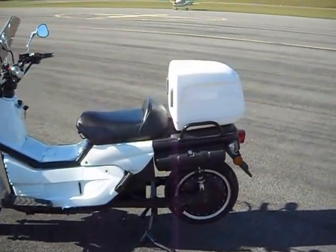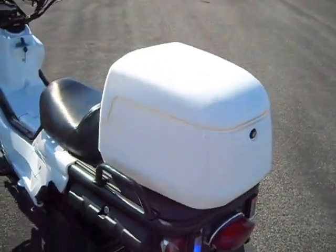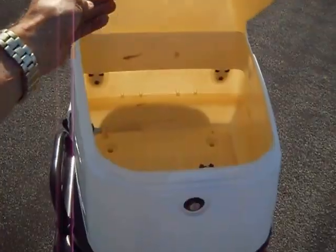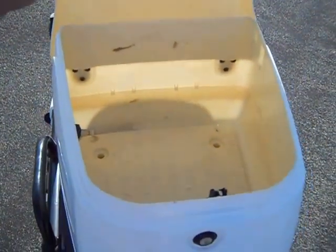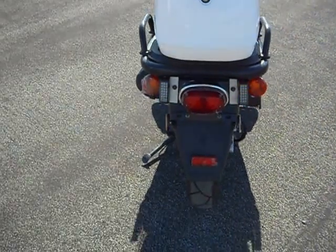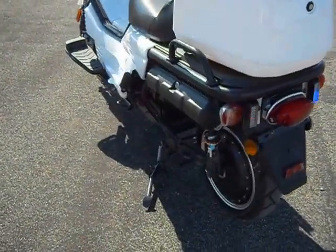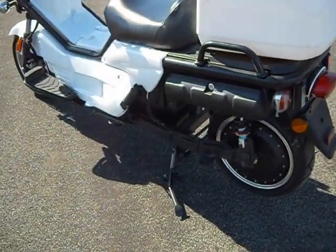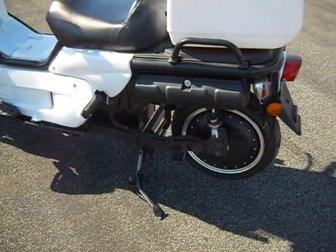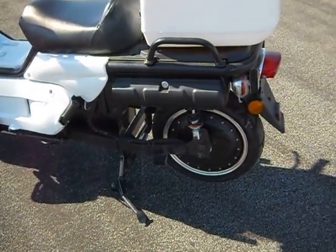The bike comes with a large rear trunk for a policeman to put his emergency kit, or it'll hold a full helmet and then some additional gear. This bike has 4 disc brakes, or pistons. There's 2 pistons in each brake, front and rear, 220 millimeter disc brakes.